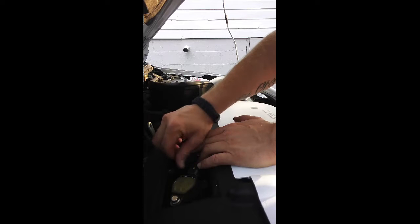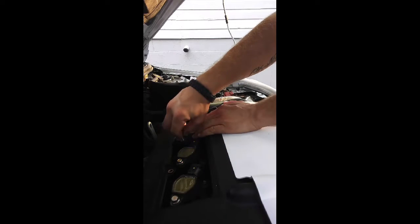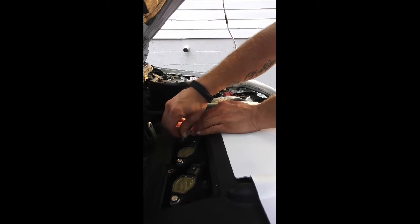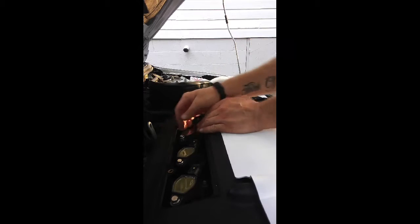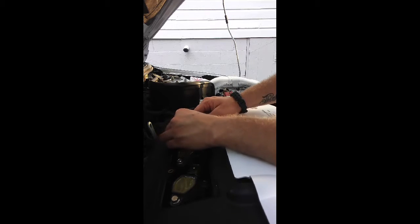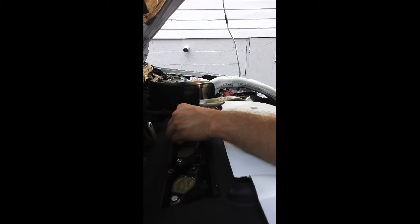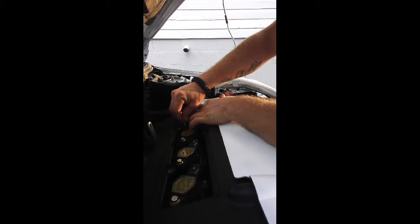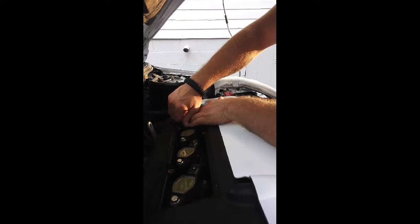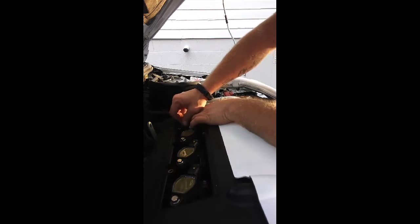Yeah, I like to hand tighten these, finger tighten these, whatever. Never want to over tighten these with the ratchet, because it's just not good, because you can, again, strip them. I did that on my old Tribute, and stripped the intake manifold off of it. Just pulled in a little extra air. I mean, it wasn't too bad. Never got it fixed, but hell, I flipped it, so no need to worry about that anymore.